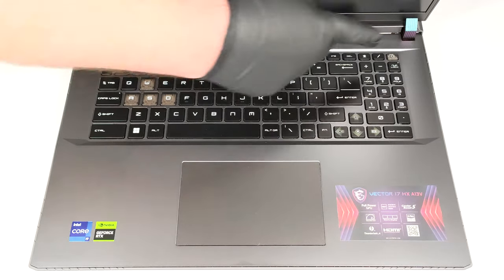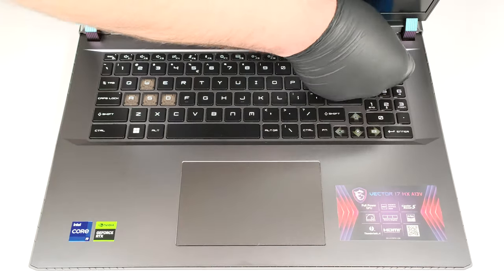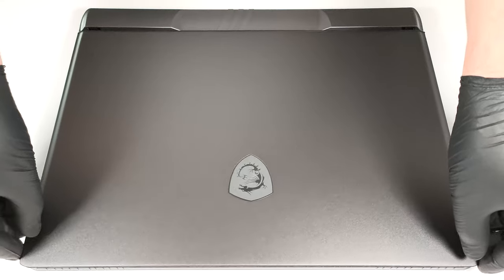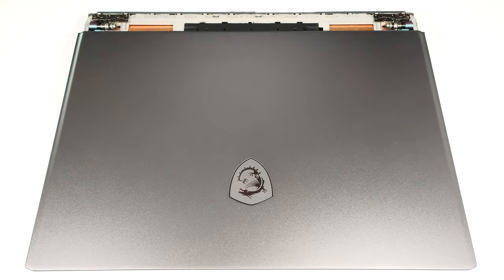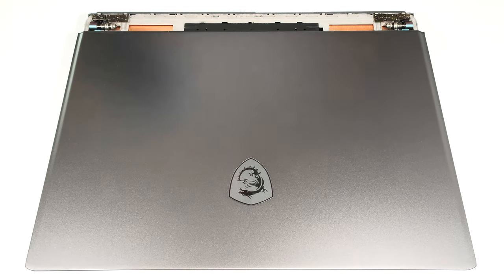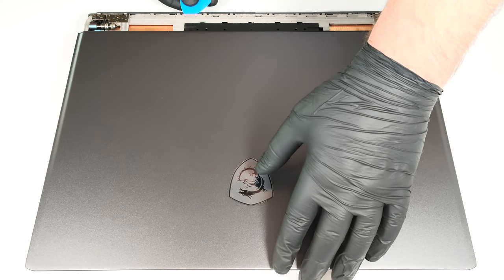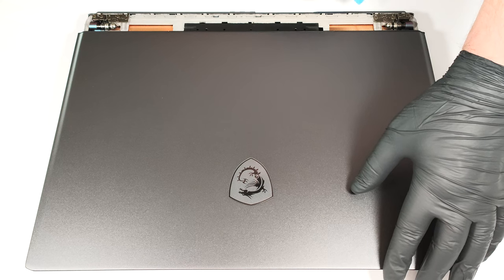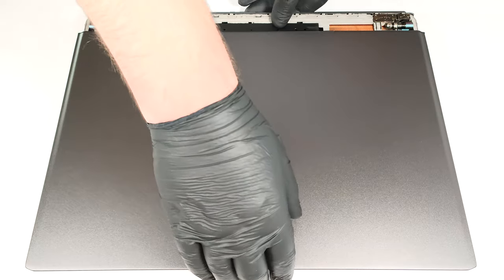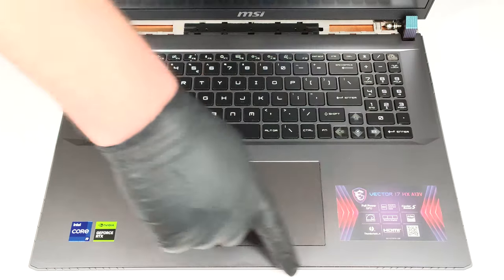Open the lid to pop the front side of the cap. Lift away the shield from the base. Now we can pop the rear. Pry it step by step by inserting the tool in between the plate and the chassis. Again, open the lid and pry the right and the front sides through the base.